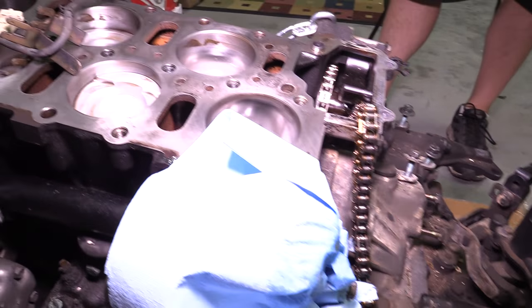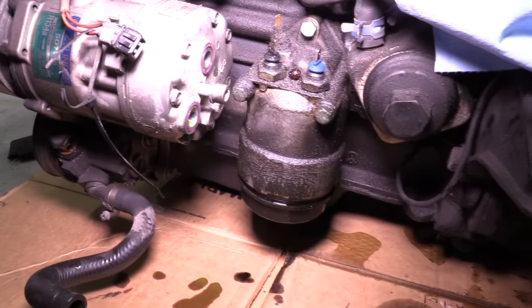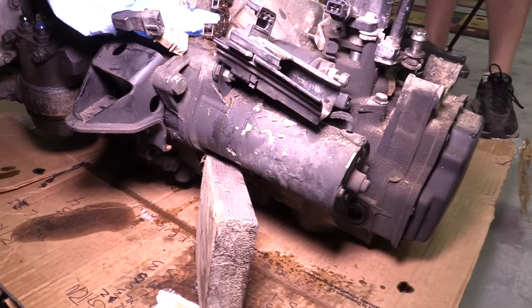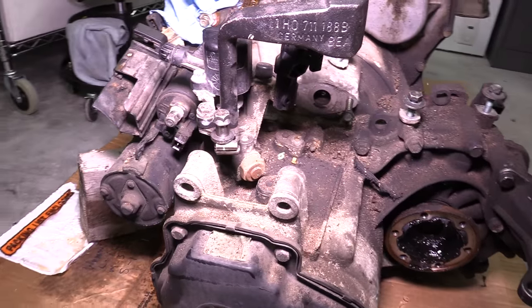There are a couple of reasons why I'm going to this level of teardown on this car. One, I want to get this engine out to do a full thorough inspection on the bottom end — pull the pan, inspect the bearings, and make sure we don't have any lower end issues. Also, it's getting timing chains, so that means we have to separate the engine and transmission in order to do that. This is a great opportunity to also put a clutch in it. This can be really easy when it's all basically on a workbench, so instead of climbing over an engine or a fender, we have it all right there in front of us.